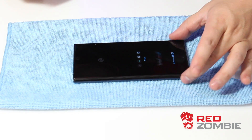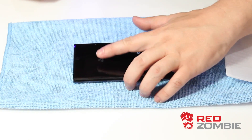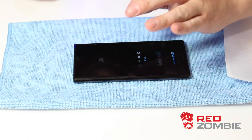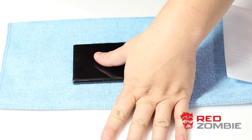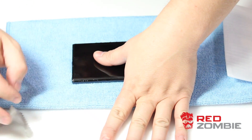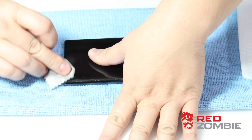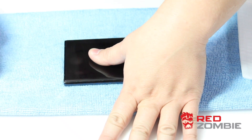The glass up top should now be stable. Use your finger and press where the fingerprint sensor is — we want to squish out as much of that liquid around the sensor as possible so that the glass we're installing is as close to the phone glass as possible. Just push, and you can see the liquid pouring out of the sides, which is okay. Just make sure we're cleaning it up as it comes out. You don't have to press too hard, but it just needs to be in the right spot. Don't worry if it looks a little messy — we can always clean it up with a little alcohol.